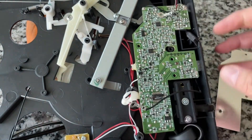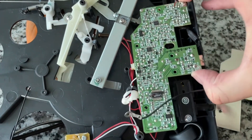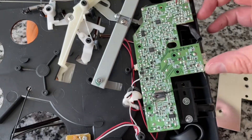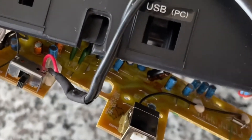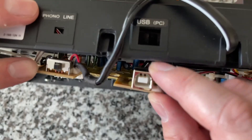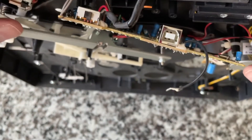This right here is the USB connection, and up here is the preamp — so the preamp circuitry is in here. Let me see if I can get a close look at that board. It's pretty tight and hard to see, but right down here it says July of 2010, which is interesting since this turntable was manufactured in 2017. It's pretty sparse — capacitors, resistors, mostly capacitors. Some of this adhesive or glue stuff might be cracking a little bit around the base of that USB. And there's the preamp switch.